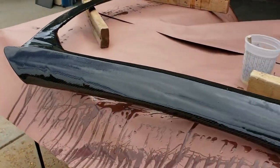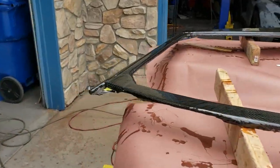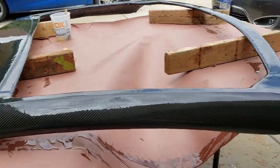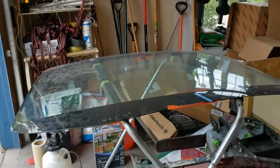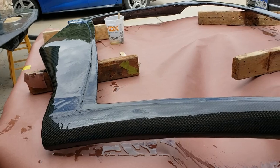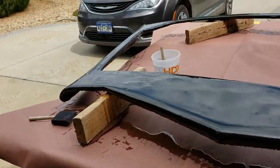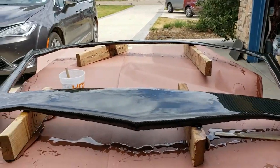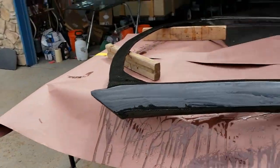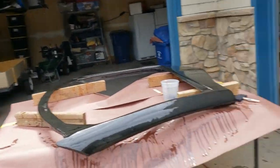This is the windshield surround. I thought I was done, and then I took a look at some of the areas and was not happy with what I saw, so I went ahead and re-bodyworked it and then put on a new layer of carbon fiber. Now it really fits well with the windshield over here. We haven't cut this yet, but we used the cracked one to set the borders around this one so it'll fit in there really nice and tightly. We've had to put two more layers of carbon fiber on the part just to keep it nice and sturdy. Today we're gonna give it a light sand, then 2k clear it, and then it should be ready to go.